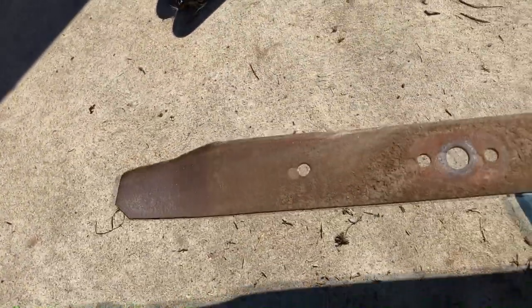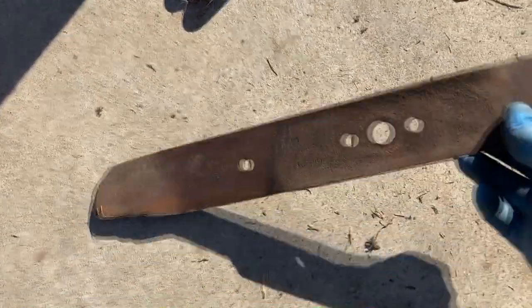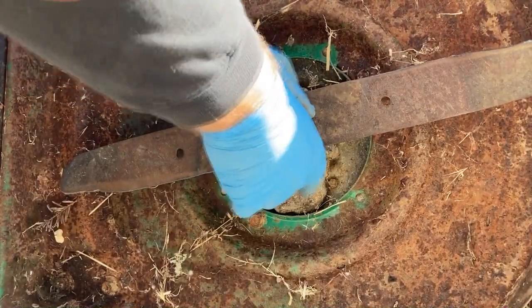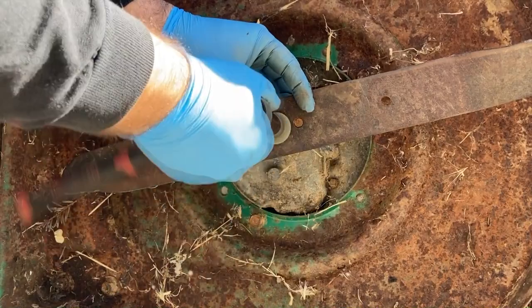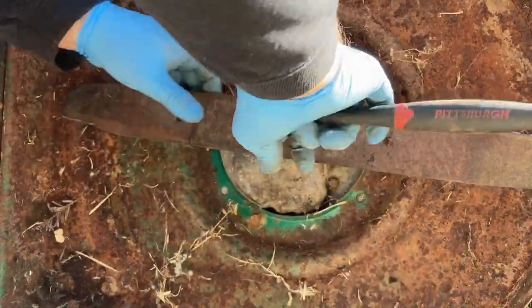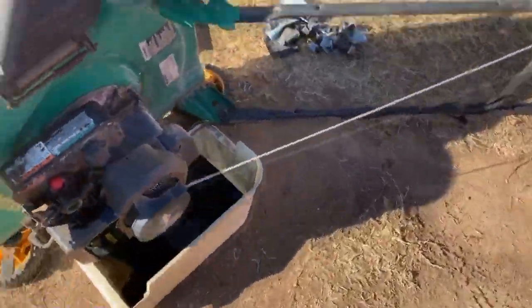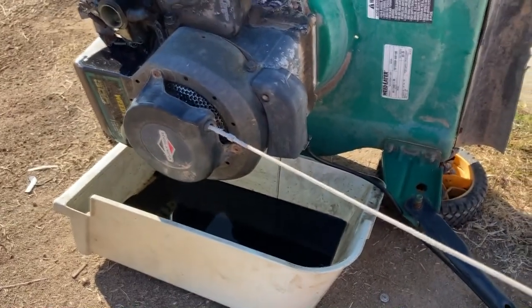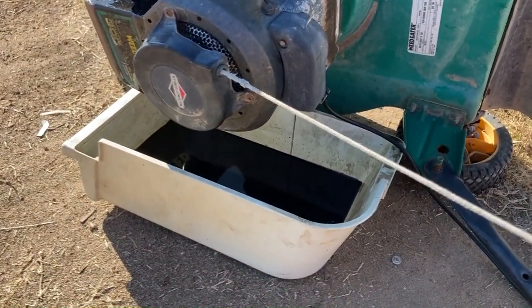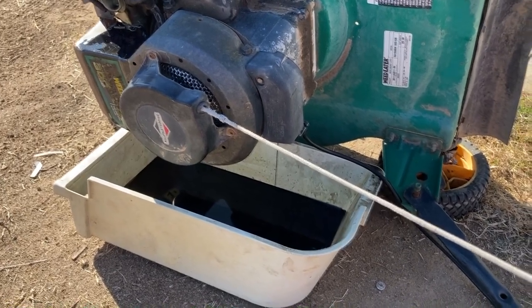The handle's got a little bit of a bend in it — that's an easy fix, not worried about that right now. The blade is balanced — it's worn pretty evenly, but this is more than good enough to stick on a mower like this; it'll still cut grass just fine. Stick it on, new blade bolt, nice and snug. Off camera I initiated an oil change — the oil's pretty black, needs to be changed. We're going to put some engine restore stuff into the new oil. These Briggs Classic engines take about 12 to 16 ounces of oil, so that's what we'll put in.